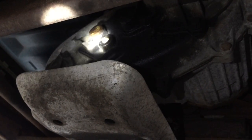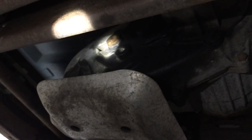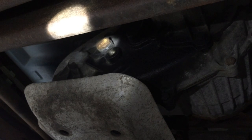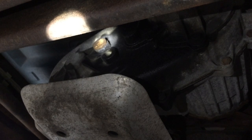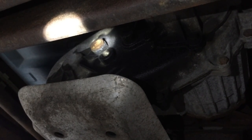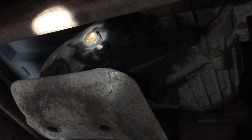In the middle of the truck you've got your transfer case. You can see that bolt hole right there — there's the skid plate, and there's a drain hole right above the skid plate, but the add hole is right up here. If you've got a truck where you can switch between two-wheel and four-wheel drive mode, you want the oil to be running out of that hole, so fill it all the way up until a little bit's oozing out. If the truck's full-time four-wheel drive and you don't have two-wheel drive mode, then you want it a half-inch below that hole.